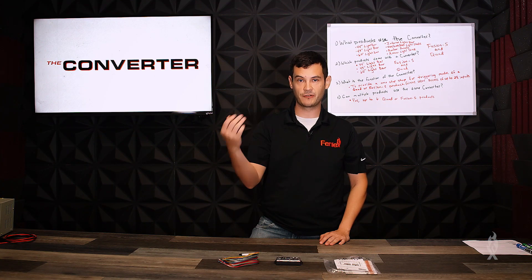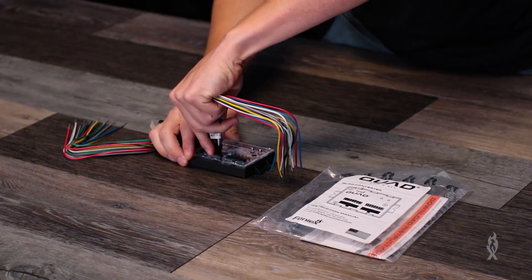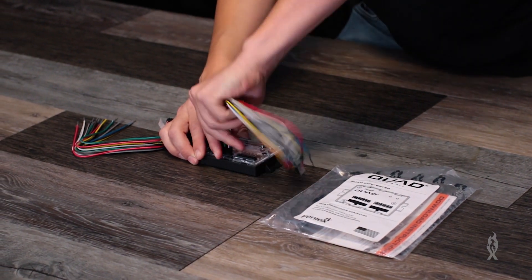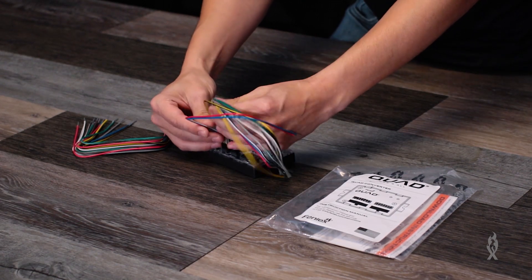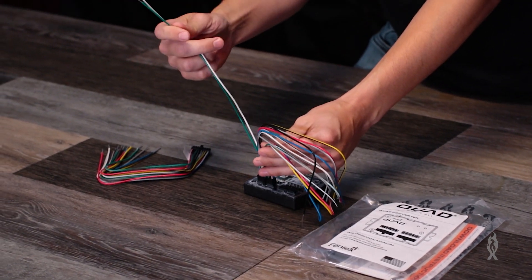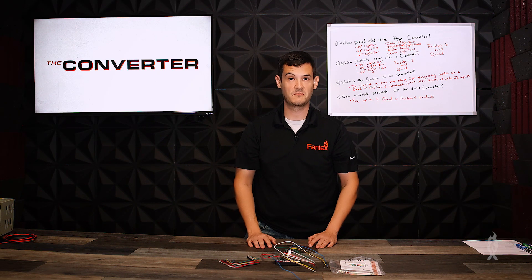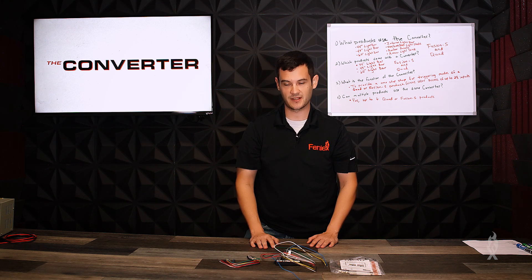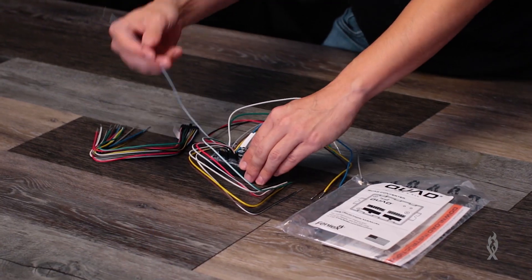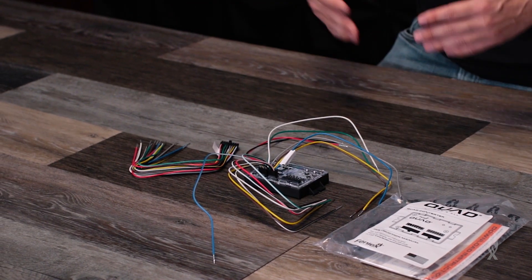So for example, if you're wiring up your Fusion S 600 light stick, you take your green-white data wires and plug in your first harness to input set one. You wire those green-white wires directly up to your Fusion S data wires. If you wanted to do mode one for a rear 600 Fusion S light stick, you would take your blue-white wire and apply it to 12 volts — that would cause the 600 light stick to flash.